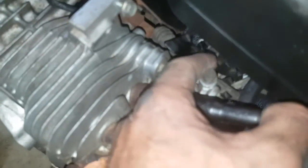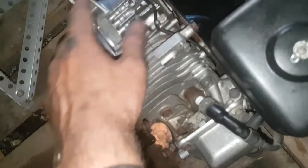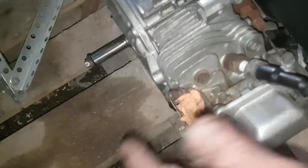accelerator, throttle. So I'll put all the linkages in. I'm wondering if I just run straight to the little throttle flap under here. I'll show you when everything's taken apart, but wondering if I just hook straight up to that with my cable, or I would have more control on the lever arm that was on here. There's mounting points for it, which is quite simple and easy, and I quite like that, so I might start with that. If I have any problems, I'll go straight to the throttle, but I predict more issues with hooking straight up to your little plastic throttle body here anyway.